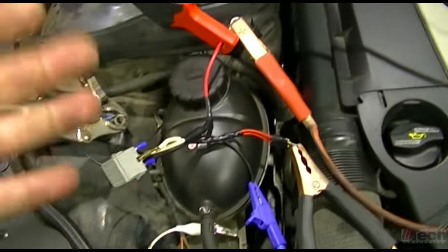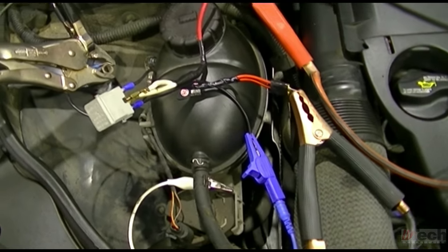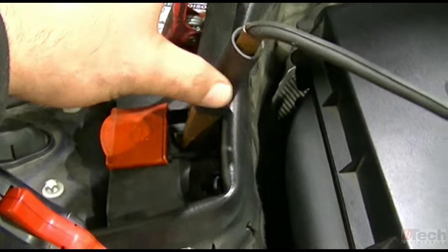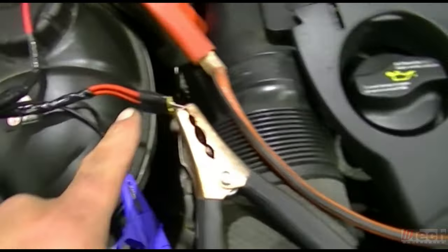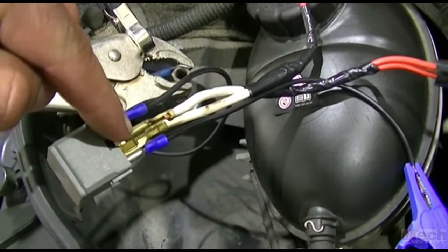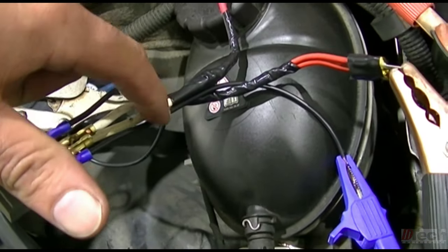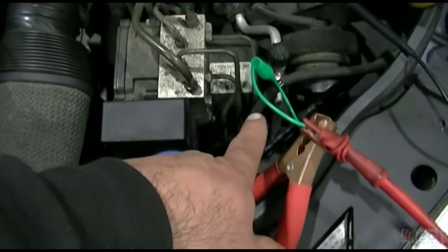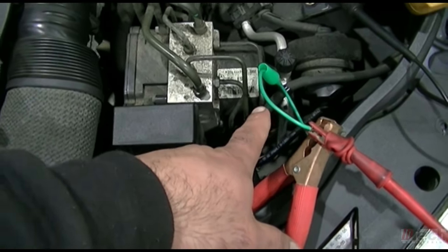viable option. And just to show you in physical form and explain, I've got this B plus, direct B plus on the black side. And here is the black side. So I am feeding into here. The other big white one, which is this one, is on the red cable, which then will feed the B plus turn on signal when the relay clicks.